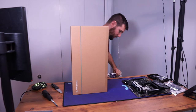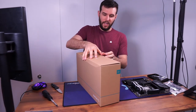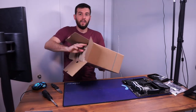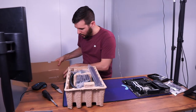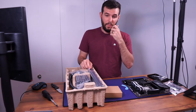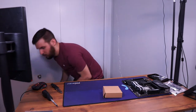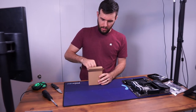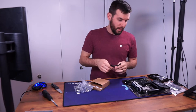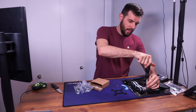I'm saying that as someone who is currently using not one but two Intel CPUs in their setup. I went with the 12700K in my streaming PC because it has a lot of cores for the stream, and I had it on hand already. In my gaming PC, the 12000 series for Intel was just coming out, and it was the newest best thing, and so that's what I went with. The 5800X3D wasn't out yet at that point, so the 12700K price to performance was really good. That's why I ended up becoming an early adopter of the LGA 1700 for my gaming PC. But looking back now, I kind of wish I had gone AMD for my gaming PC because I could swap in a 5800X3D on an X570 motherboard, and my setup would be getting so much better FPS.